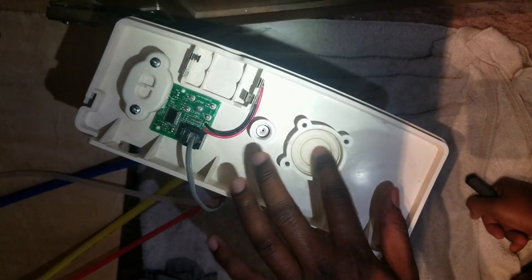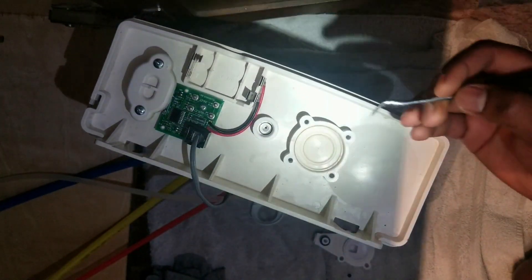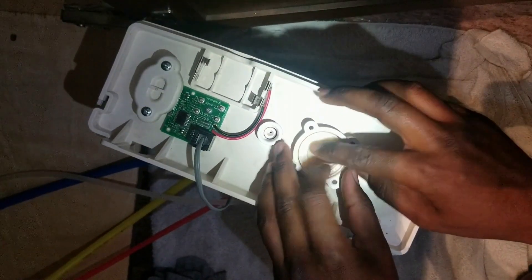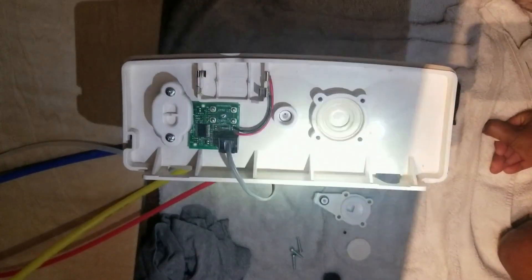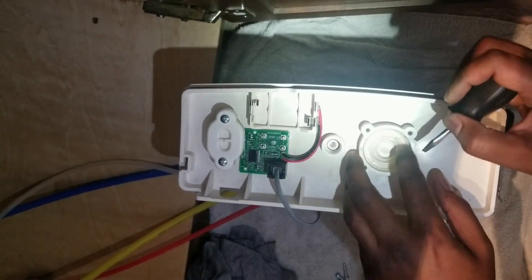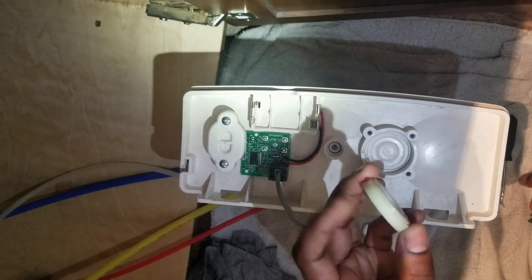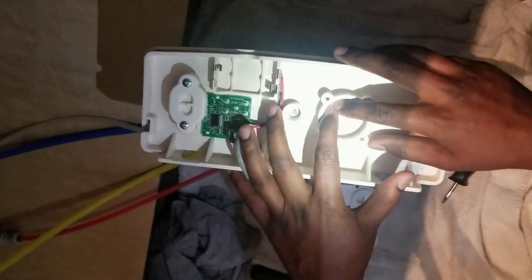There's also a spacer ring and a plunger inside. It'll be very snug and tight — you might have a hard time getting the plunger out. You can use a small pry tool. Turn it upside down if needed. I had to use a small screwdriver; there's a little groove in there, so I pushed it in and rotated it to get it moving. Once you rotate it a little it gets loose, otherwise it stays stuck due to the water seal.